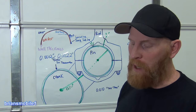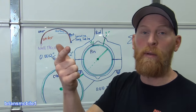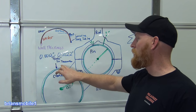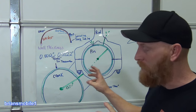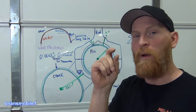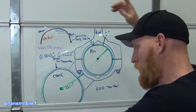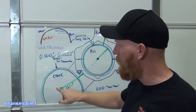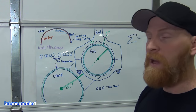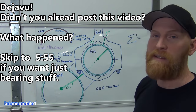The main point of rod bearings and main bearings is they're a mechanical fuse, and they are the tool by which you set your oil clearance. Oil clearance is critical because you cannot have your engine block and your crank touch — they can never touch, nothing can touch. Everything has to be supported by an oil film. They call that a hydraulic wedge, accomplished by centrifugal force increasing pressure and also the force of oil supplied by your oil pump. If you have really big clearance you lose oil pressure, and you can have rod knock and wear and all kinds of bad stuff happen.